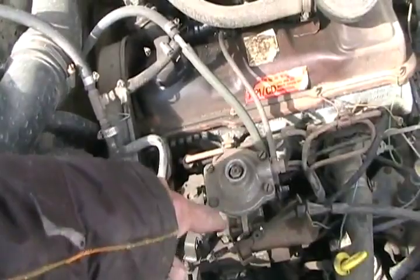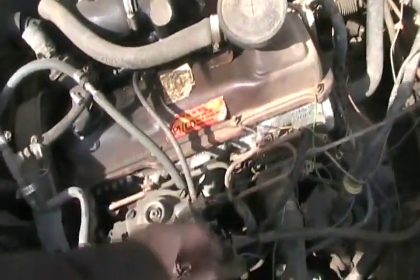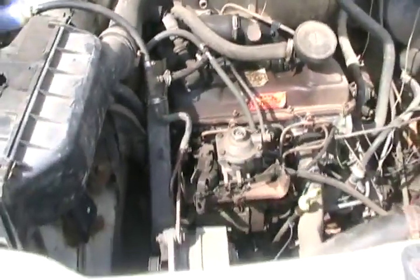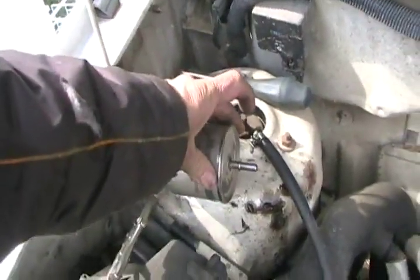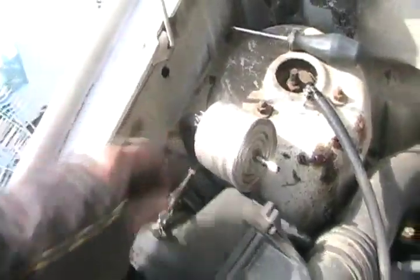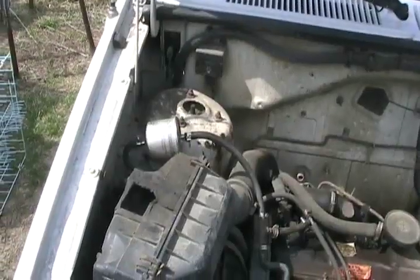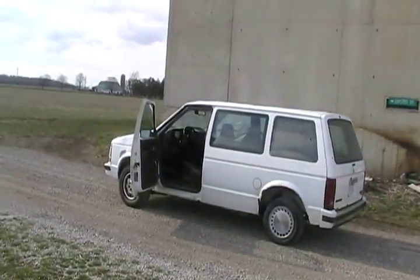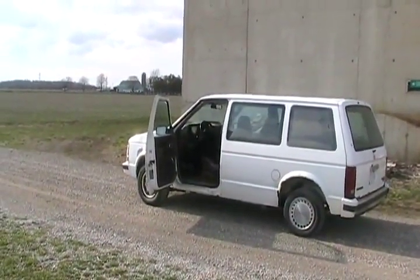What that does is it sends extra fuel back to the tank, purges out the air, preloads the injectors a little bit, and you're all set. Then before you take off your clamped vise grip, reattach the fuel line, make sure it's airtight, then release the vise grip, and go start your engine. Just what I did. It works perfect. All done. Big diesel, little diesel. Back home and be driving this thing the rest of the summer. Why not? And save more money to buy more beer.